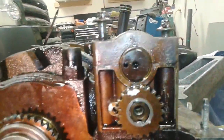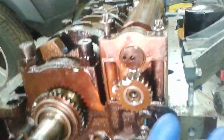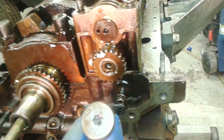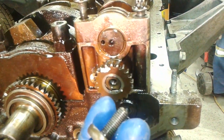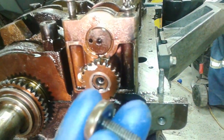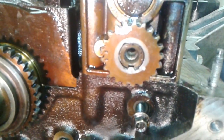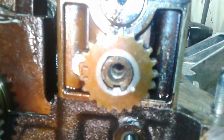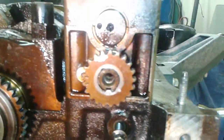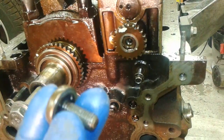We would actually proceed by using a four millimeter pin in the further rotation of the balancer shaft, and we would use the actual bolt — this is, I believe, a torque to yield bolt. It's important that you replace this with a new one because it is torque to yield. If you reuse the old one, the bolt head may shear from the body of the bolt, and you will have a very difficult situation dealing with either a replacement part for the entire bevel cut gear and shaft or drilling out the broken bolt inside the bore of that shaft. My recommendation, because it is keyed, is to go 11 foot-pounds plus 20 degrees if you have to reuse the old one, and be sure to use Loctite so it can't back out.